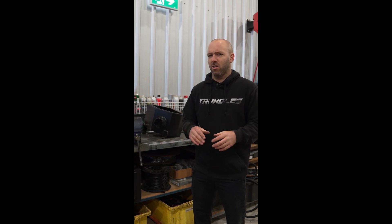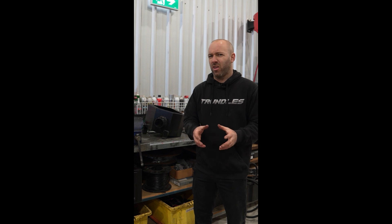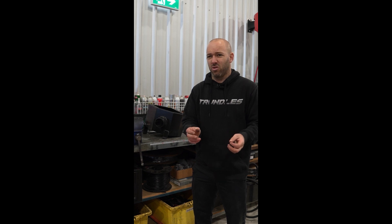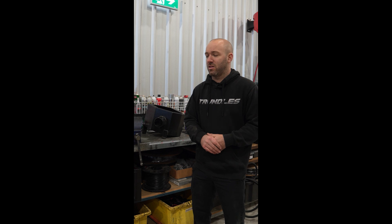When we manufacture an airbox for a vehicle, I get a base run on the dyno and we also generally log the airflow meter, then we 3D print the components and test before we fabricate the whole thing to make sure it's correct. Sometimes if you're going from a panel filter to a pod, the location and how close the bends are matters — we even had a silicon joiner change in length by 20mm and it started maxing out an airflow meter because of its proximity to a bend, which was never fun on a Friday night.